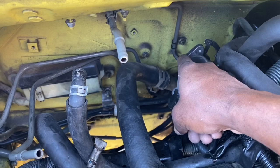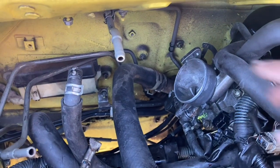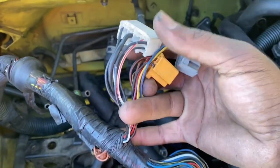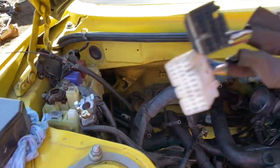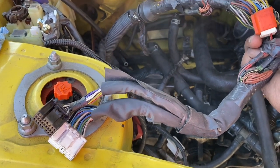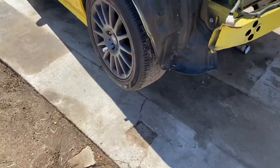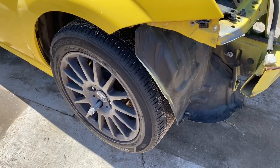I got my throttle cable taken apart — it was just two 10 millimeters and wasn't too bad. I was able to finesse and wiggle out the throttle cable from the wheel well. The engine harness is three plugs, plus the two plugs that disconnected from the ECU, and two others that are probably for speed sensor and cluster wiring. Now that I've got all that out, I can start on the suspension. The car is jacked up, I'll take these wheels off, and then we'll talk about what we need to do to take off the subframe, struts, and axles.